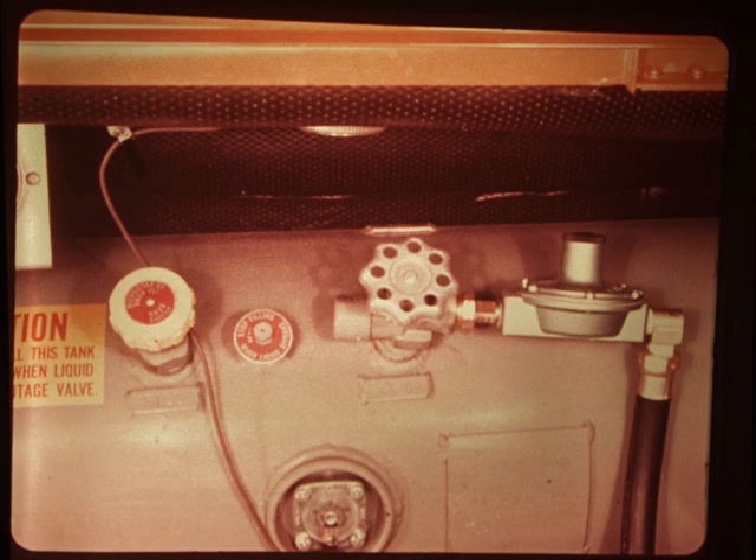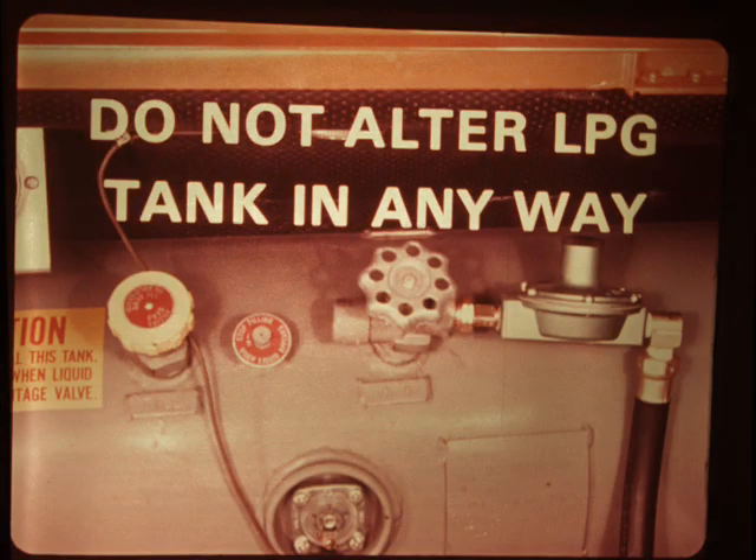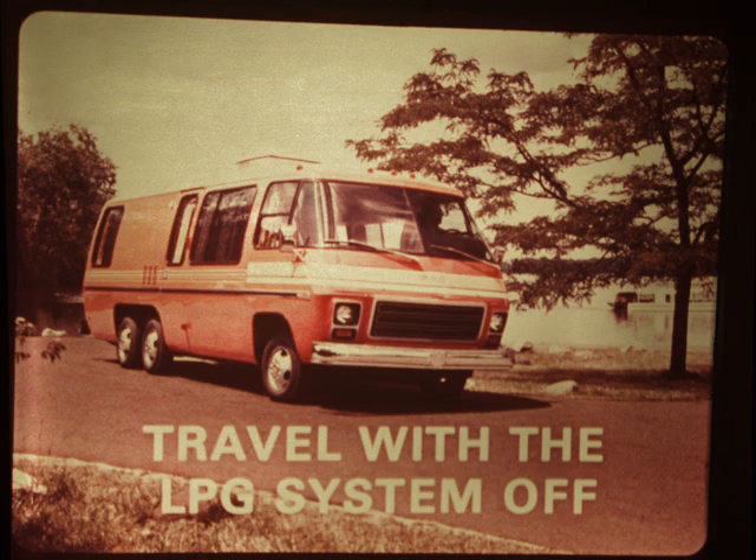Because of the flammability characteristics of liquid petroleum gas, there are a few precautionary measures which should be practiced. First, before the LPG tank control valve is opened, the controls for all gas appliances should be checked to make sure they are in the off position — if they aren't, gas could accumulate inside the motorhome creating a fire or explosion hazard. Second, the owner of the motorhome must not alter the LPG tank in any way; the regulator on the tank is preset and only an authorized service technician should adjust it. Finally, to help reduce the hazards of leaking gas, it is recommended practice to turn off the LPG system when the motorhome is underway — all pilots, burners, and the LPG tank should be turned off. This should also be done when the vehicle is not in use.